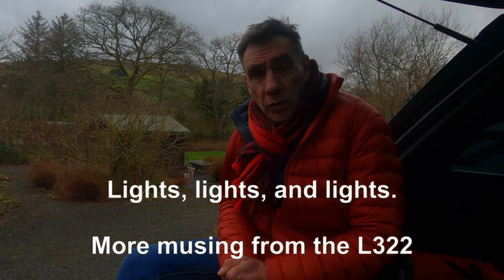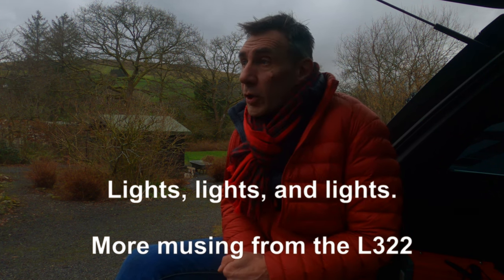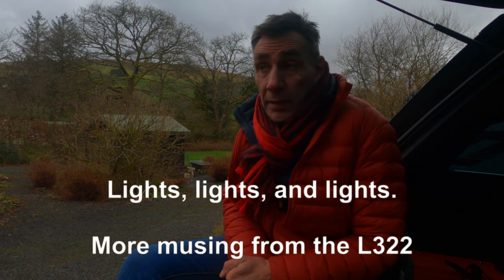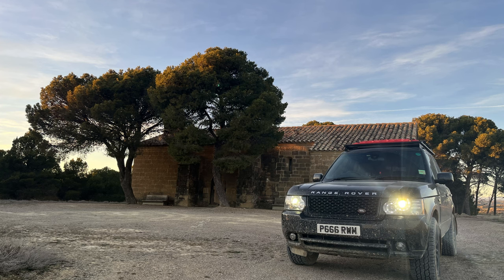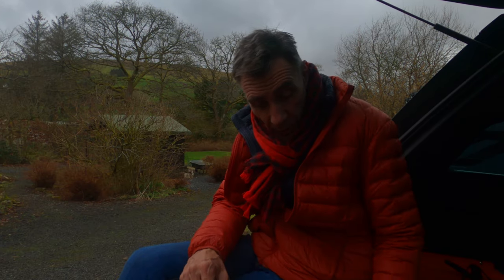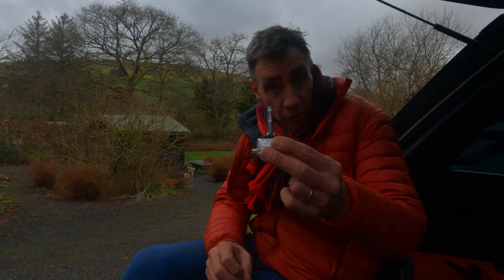Welcome back. Let's talk about lights. Looking at some of the videos I recorded, especially when I went through the dry riverbed and busted up my fog light and the surrounds, which obviously needed replacing. When I got back I noticed in a photo that my headlights seemed to be yellow and not bright — not that crisp white. So I opened up the cap on the back of the headlights, took out one of the D3S bulbs, and noticed how cloudy they are.